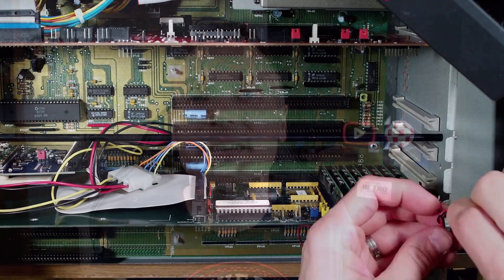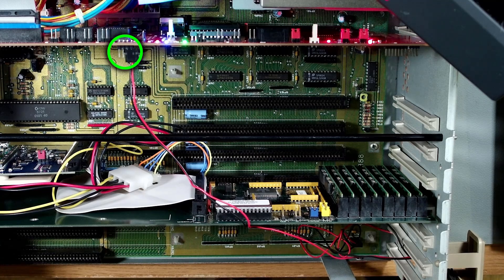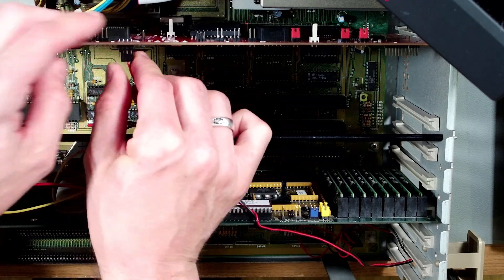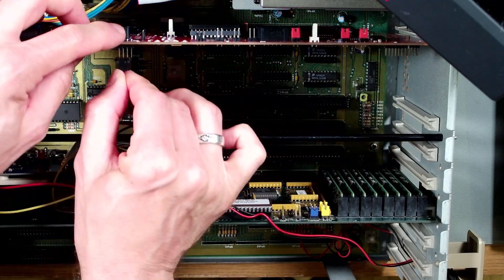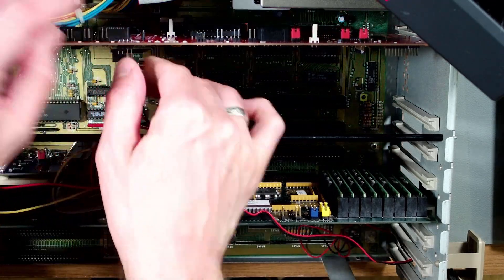I'm not planning on using the hard drive on the GVP card anymore, so I'm going to connect the LED on the front of the machine to the IDE interface instead — it makes more sense, and it means I can hide the constant flickering caused by the Blue SCSI Ethernet hack I did. The header on the back of the card is for two LEDs, one for each IDE channel. It took four attempts to get it right — not only the wrong channel, but as typical with LEDs you always connect it backwards first. And in my original video when I installed the GVP card, I now remember the hard disk LED on the front of the case was wired backwards anyway. Nice one, Commodore.